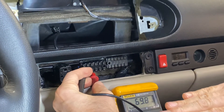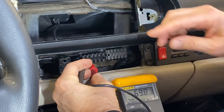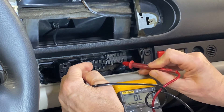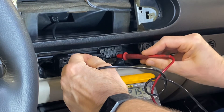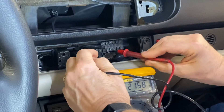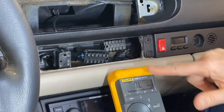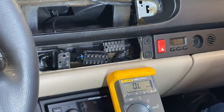That flap is fully closed, it looks like. And then if you wanted to check the other side of the potentiometer to make sure it's all working, it's A12 to B6. B6 is on the bottom row, right here. It shows 21.59. And that's about the range you'll see on all of them. If you flip the motor using power, those values would change — when you check on the B6 one, it would be more like 75, and then more like 21.50 on the other direction.